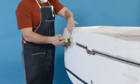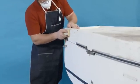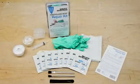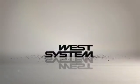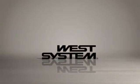Step 8. To prepare for paint or gel coat, wet sand with 180 grit sandpaper. Follow the paint manufacturer's recommendations for final preparation and application. That's about it for this project. The WestSystem 105K Fiberglass Boat Repair Kit contains everything you need for fiberglass repairs on your boat. For more information, visit us at westsystem.com.